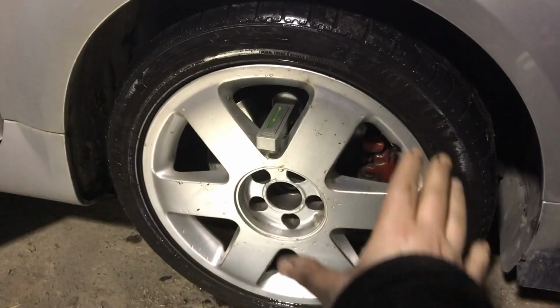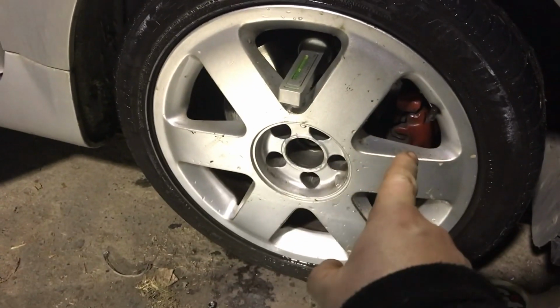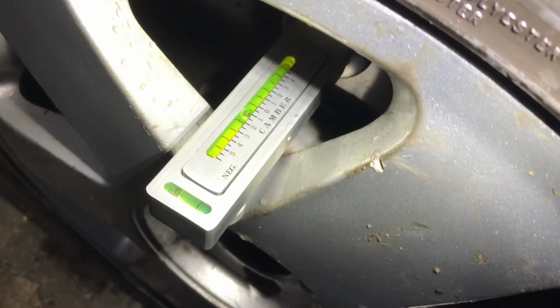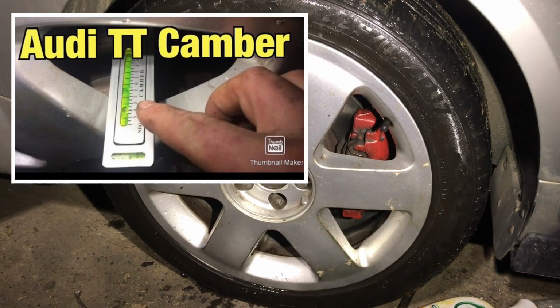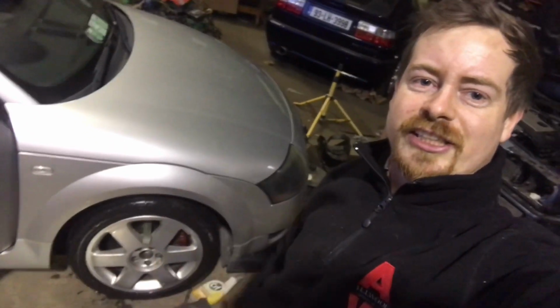Okay, now after reassembling everything, getting everything back, resetting the camber, we're just going to test that it is actually right. And there's our camber gauge reading -1. So if you want to see how I did the camber, check out the video in the description down below. So that's now the outer CV joint sorted on the Audi TT.